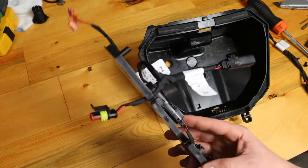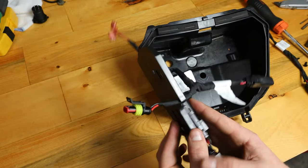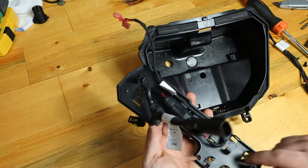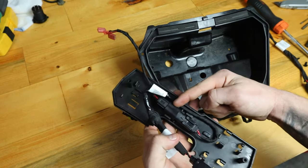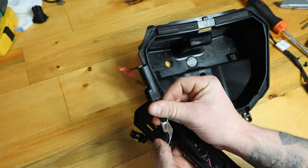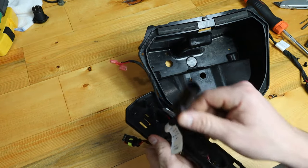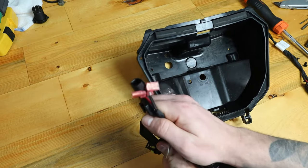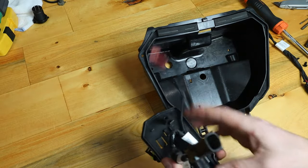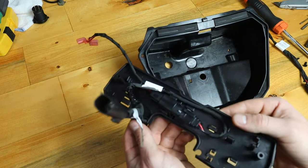Hopefully you guys can see this. I just wanted to show how I have this routed — it took me a little bit to figure out, so hopefully I can spare you some time. This is the plug that goes to the phone mount heater. And then on the bottom side of this plate, you have an accessory plug that you plug the USB wiring harness into, and then you have another accessory plug that's going to go back to the plug that we identified on the machine behind the panel. So this wiring harness and this wiring harness have to go through that three-quarter inch hole. I took the grommet back out just to make that a little bit easier.